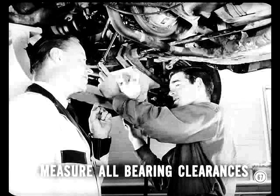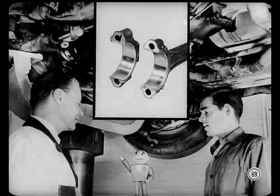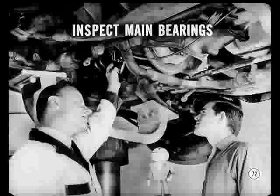Since this one rod bearing was worn, we'd better measure the clearance of all the rod bearings to be on the safe side. We put in a new set of standard-sized bearings on all the rods, making sure the tabs on the bearings lined up with the grooves on the rods — all of the old ones showed too much wear to take a chance. A small piece of foreign matter on the journal could embed itself in the lining material and damage both the bearing and the journal. Foreign material behind the bearing can cause a high spot and result in damage. So we wiped off the journals, caps, both sides of the bearings, and torqued the rod bolt nuts to 45 foot-pounds.